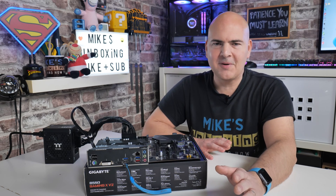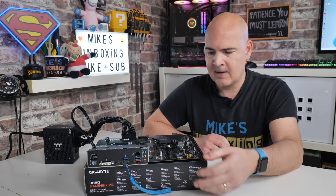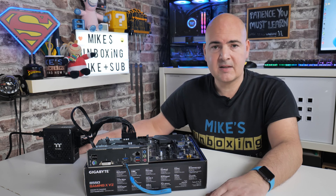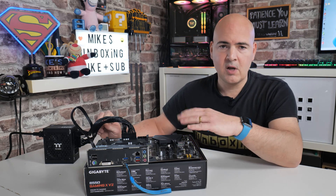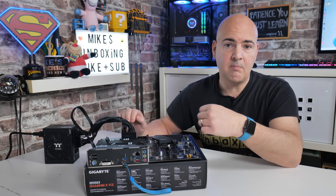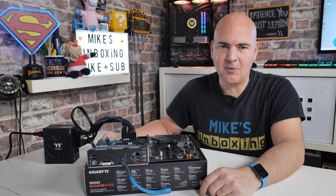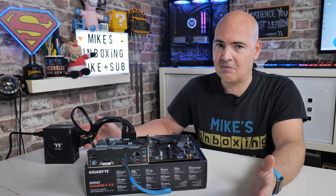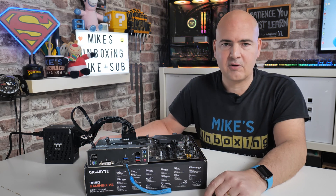We're basically ready to build our PC now — which is again another reason I'd suggest doing this first, just to make sure everything works. At this point, before you put it into your case, you might want to set up a little test bench: put in your graphics card or APU, some RAM, so you can get it booted up and see a BIOS screen — obviously plug it into a monitor. If you want to take the risk, go ahead and stick it in your case and build it all up. If things don't go entirely as planned, don't forget you can contact us on our Discord — there'll be links in the video description — for any additional help with Q-Flash on these Gigabyte boards.